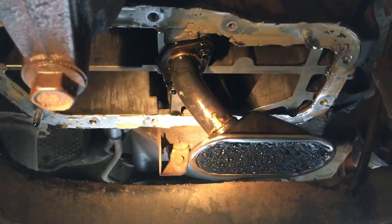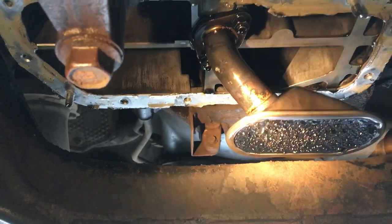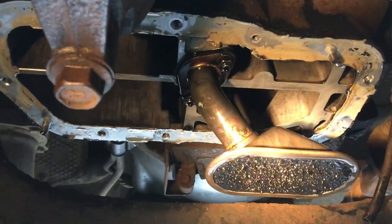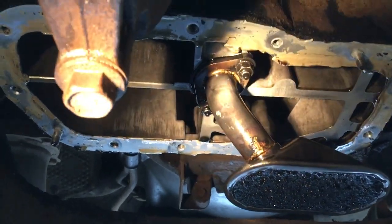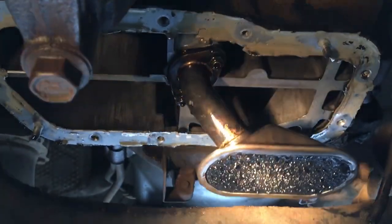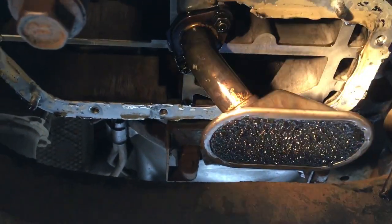Another really important point when you're checking your oil pickup — make sure you know what you're looking at. We don't want to be pulling oil pickups that have got a bit of silicon or fluff from a rag, thinking that's blocked, and pulling the sump off. You do not need to remove the sump sub-assembly just to check your oil pickup. You just look through the hole.